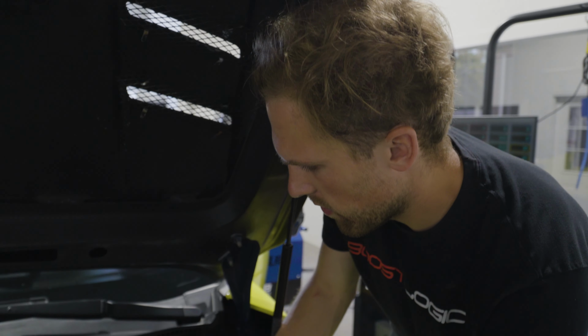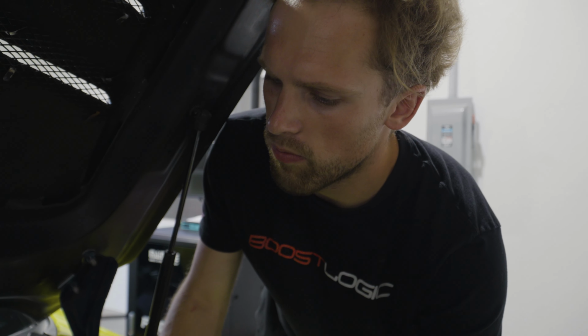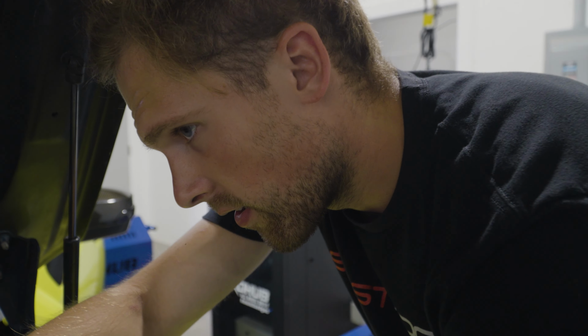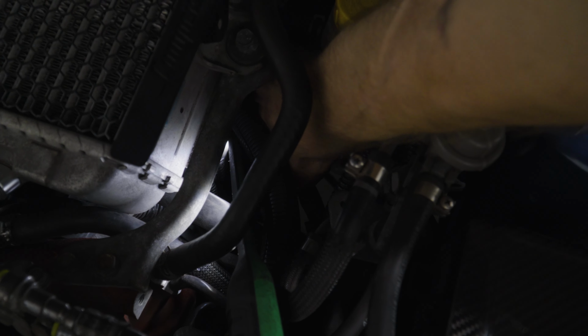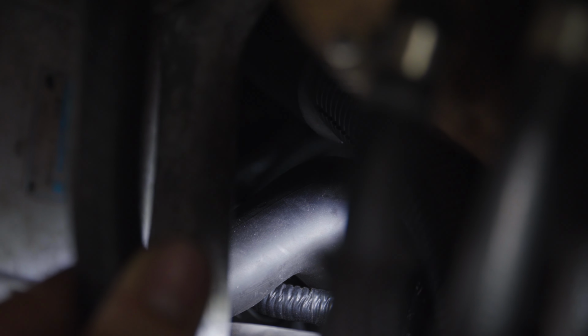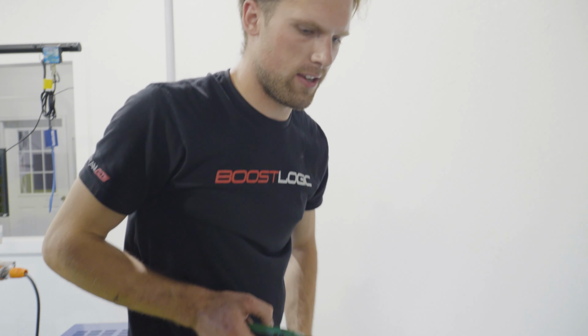So he was having very weird readings on the Access Port, and I basically nailed it down to if you turn the key on or off, they would show really weird readings randomly. So I just wanted to check the grounds. That ground in front of the coolant tank is good, it's tight. But the one that goes from the battery to the block, I can literally just flop it around. That's your ground cable just flopping away. I'm going to see if I can get it from underneath first. If not, I have to pull the top out.